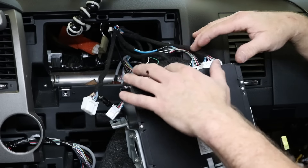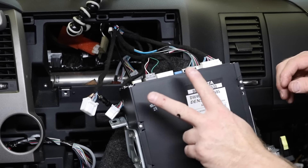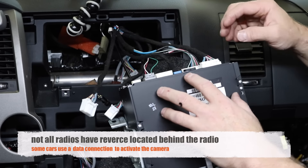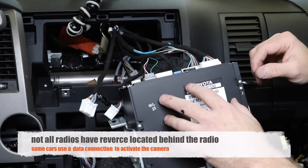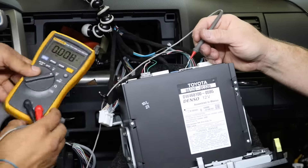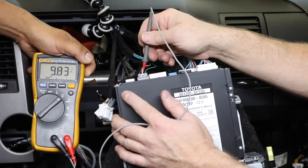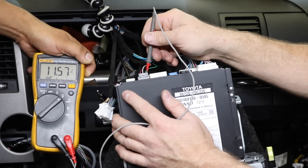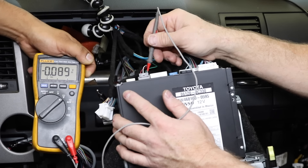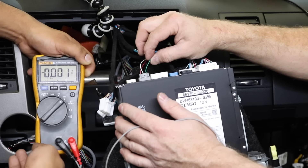So what you want to check is to see what each one is doing. This one has fewer wires, so I always want to start there. Now we know there are two things it takes to get the backup camera to come on: one is the reverse wire, and one is the actual signal going to the camera. So we're going to probe for reverse first. We want to take our voltmeter — put your ground there. We got nothing. We got 9 volts. We got 11.75 — more than likely this is going to be the reverse wire. We'll take it out of reverse. Boom. So we know this is the reverse wire, so we can hook this up to our aftermarket radio and have it trigger the reverse.